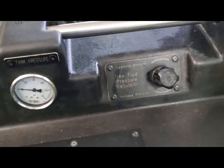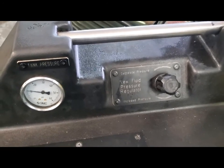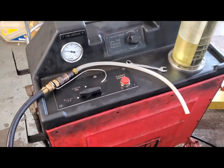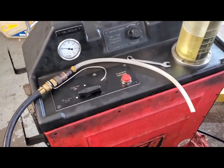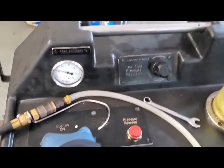So let me get my 7/16 inch wrench and see if I can get to the bleeders in the back. This is the pickup tube that scavenges the old fluid — you hook the rubber tube up to the bleeder before you open it up, and there's the suction pump on the machine here.